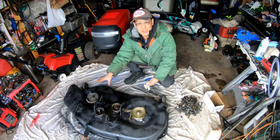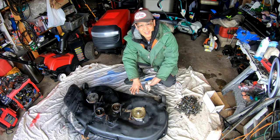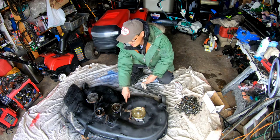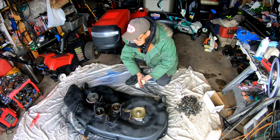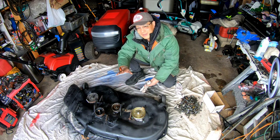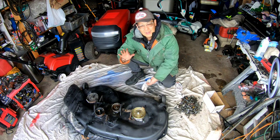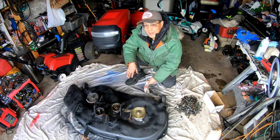Unseizing the seized spindles on this good deck, putting some new spindles, pulleys, and spindles on this one, right? Getting the brake arms and tension springs placed on here, unseizing the mechanism that the tensioner arm works with, tightening the belt when it's installed. Repainting this again to get ready to put this good deck on this Swiss cheese deck. So we'll do a deck replacement in another video.